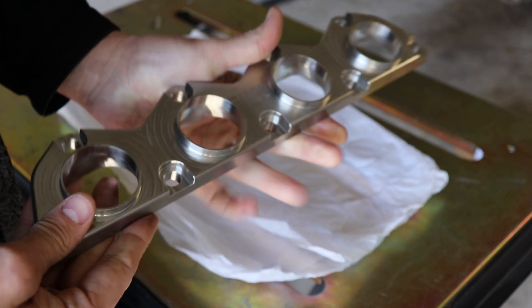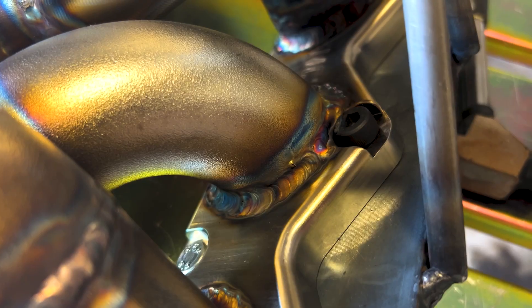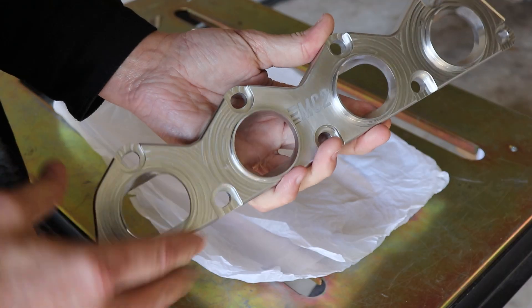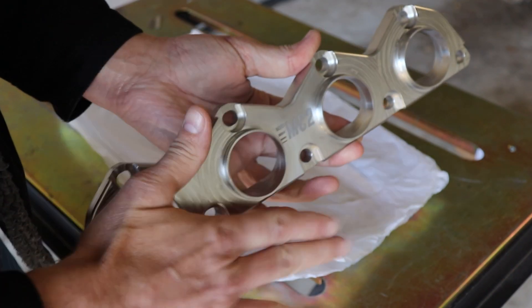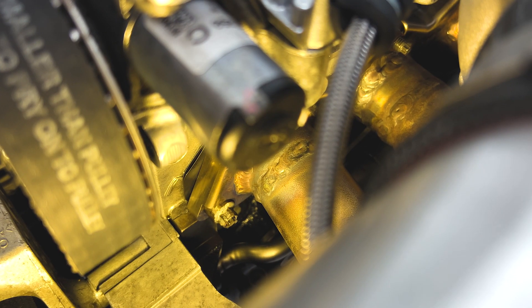I've got a little bit of a leak on the side. It was fine when I initially welded it up. However, because I didn't mock it up on the car before I fully welded things up, I did have to go back, cut it, and lengthen it about three quarters of an inch, which I did off camera. You can see here where I added these extra little legs — I've got a couple sections where I normally would just make this a single piece. You can see right down in there where there is a little bit of a gap because that ear just lifted up just a hair, just enough to make this thing want to leak.